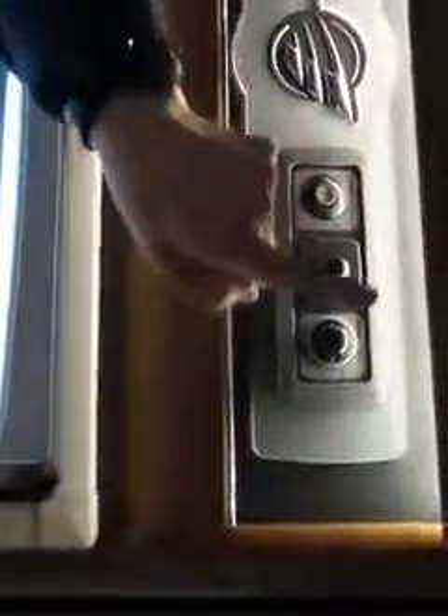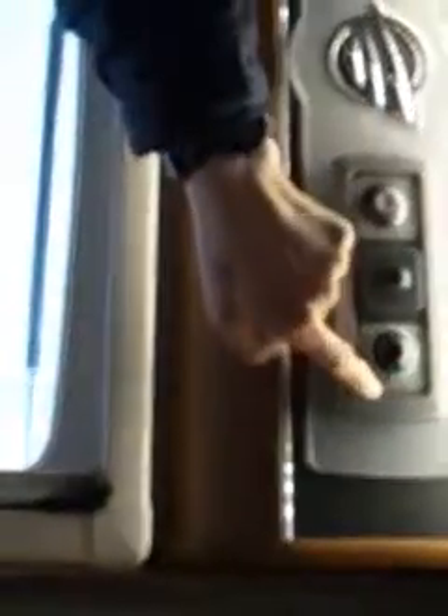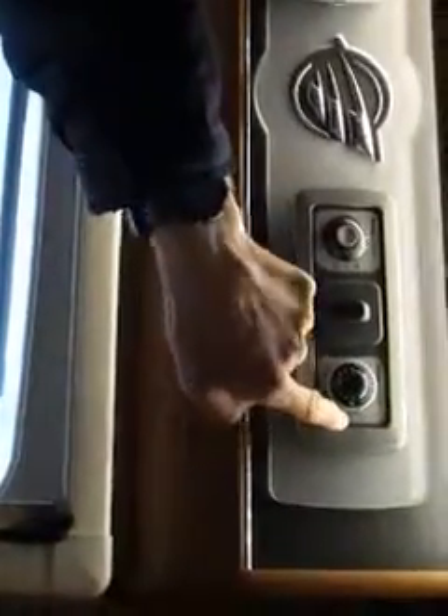Switch that isolating button on and you've now got options when you switch it on of 500, 1000, or 2000 watts — 2000 being the hottest. And there's a thermostat in the centre. If nine is lined up with that zero there, that means it's set to the hottest. It heats an element up in the fire which is underneath your wardrobe, and that'll obviously start warming your van.